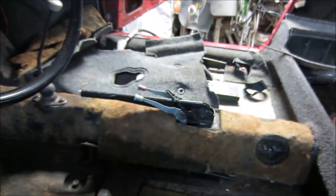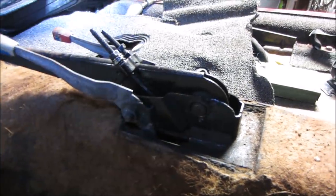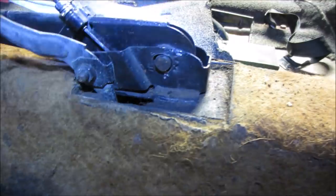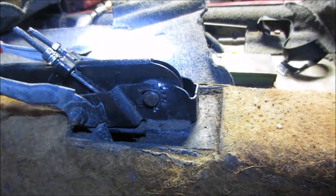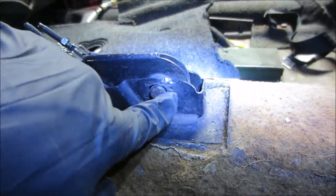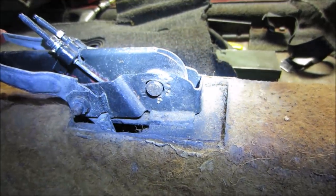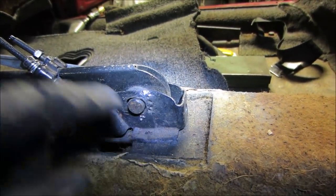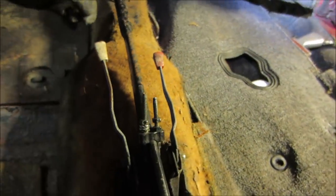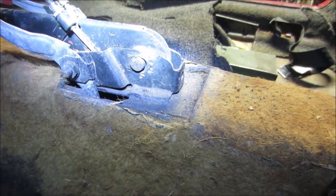I took the center console carpet out of the way. I was looking into the shifter and emergency brake. The shifter is flopping in the breeze, and the emergency brake is also flopping in the breeze. Somebody egged out the back of the socket where the pin goes through — not quite sure what happened there. They tried taking a punch and punching the material up to give it more room. The emergency brake was laying off to one side, not staying in the center of the car. So I'm going to fire up the welder and build up some weld in that back bracket to give that post something to lean against.